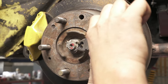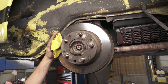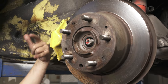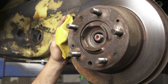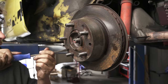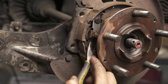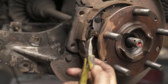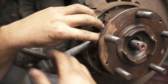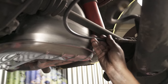Now that we have the spring plate out and the torsion bar out, we're going to move to the axle nut — just pull the cotter pin out of the castle nut. Next up we're going to remove the caliper, the rotor, and then disconnect the e-brake cable inside. I've already removed the two bolts that hold the caliper on — those are just two bolts in the back needing a 19mm wrench. Once those are out, pop the caliper off. Take out these flat heads and the rotor will come off. To disconnect the e-brake cable, come in and take out this cotter pin — that should wiggle right out and I'll replace it with a new one. Then remove the castle nut and pull the e-brake cable right out of the back.